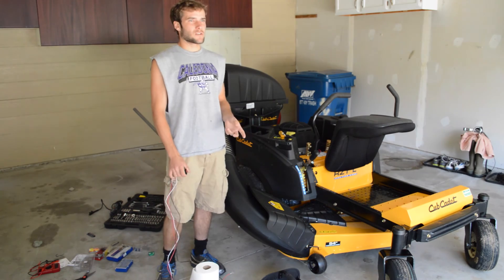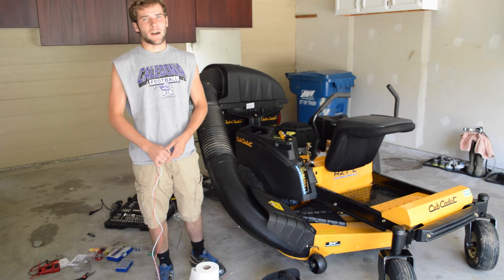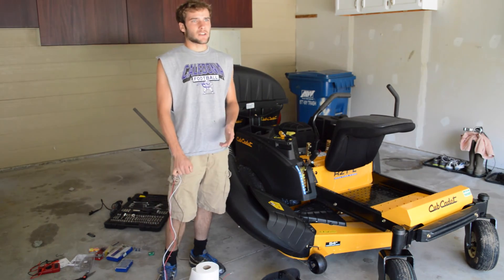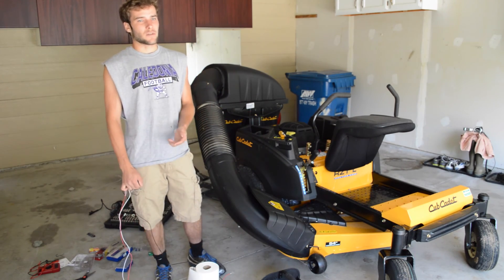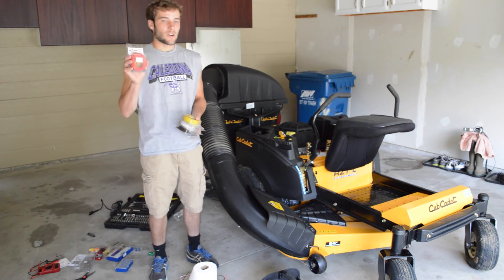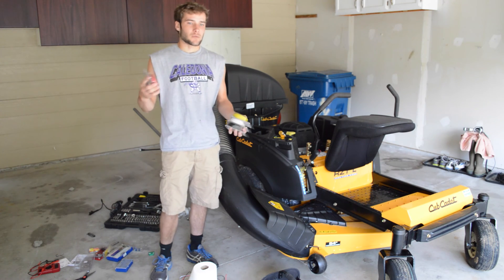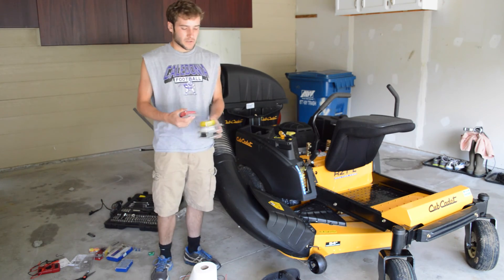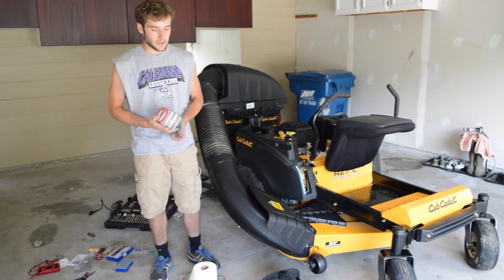The stator or alternator in this engine produces about 180 watts, so that can charge your battery back up pretty quick after starting it. The light uses about 90 watts, so if you leave your light on with the engine turned off, your battery is going to drain pretty quickly and that could be a bad situation. One important thing is to make sure you know the wire capacity of the wire you're using. I'm using 16-gauge wire which should be good for around 20 amps on a lawn mower project like this. You can look online for charts - I'll post a link to one.